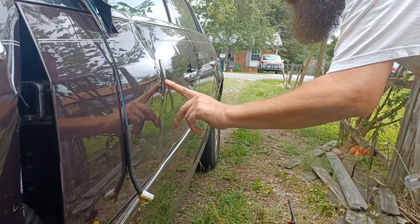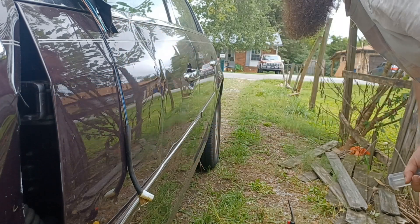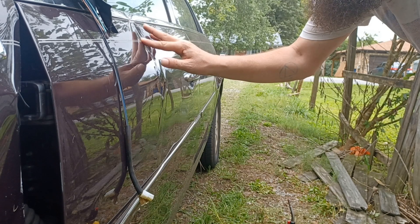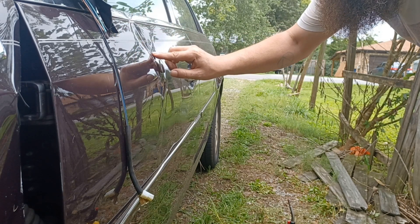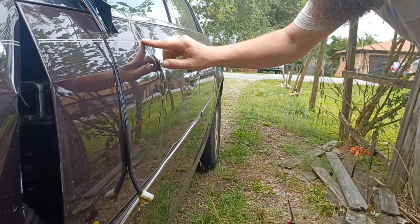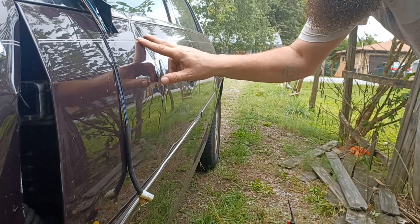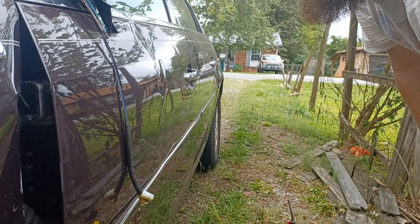We've still got a little warp there, still got a little dent there. That might be big enough I could pull something. Hammer here a little more, maybe tap right there just a little bit — don't want to put it back in. That dent's about that big, which could be big enough to pull the middle. Let's see if we can get this top section out — I'm not confident on this one. The smaller a dent gets, the harder it is to pull. You need a more concentrated area with a pretty good amount of force.